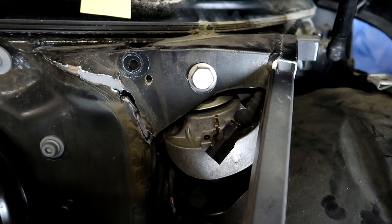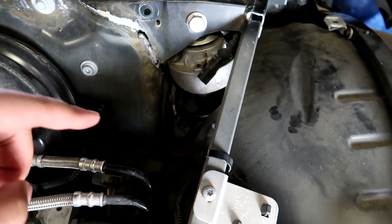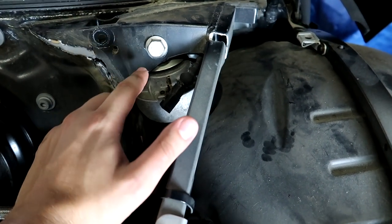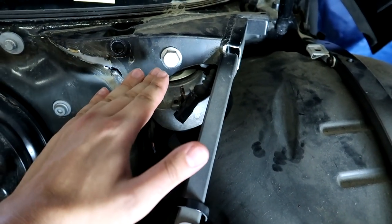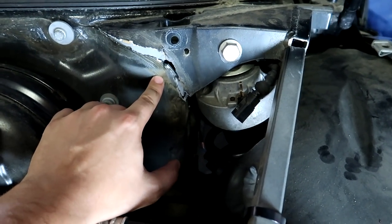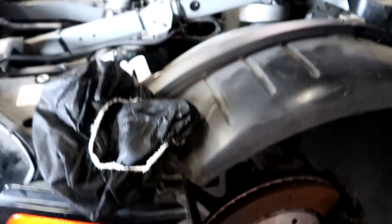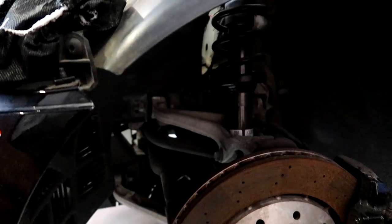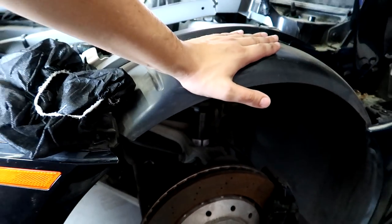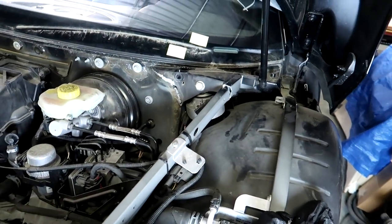So basically, with the car on the ground, with the jack stand somewhere close underneath this area here, we need to get this shock removed, and then we need to pull in the reverse manner that this shock was pushing up on the frame of the car. If we can do that and get this to come back in place, we'll need it welded, reinforced, and the job will be done. The shock's really only held in place in two places, one right down here, one up top here. We might actually have to remove the control arm here in order to get it out. I'm not positive yet. We'll figure that out shortly. But once that's done, we'll remove the fender liner right here, and we should have direct access to hook up frame tools and start pulling this thing.